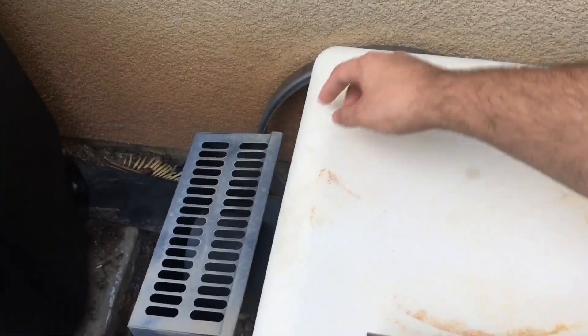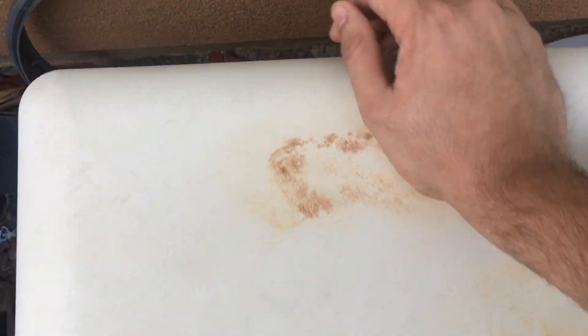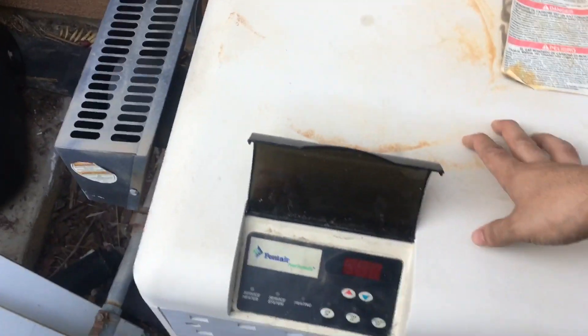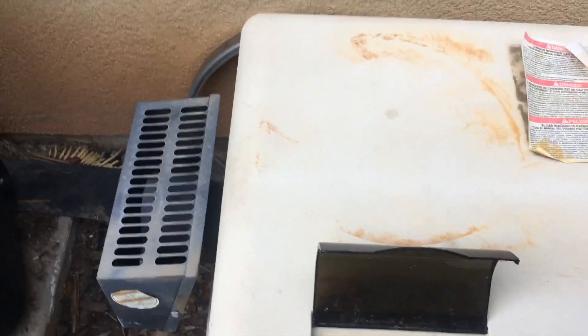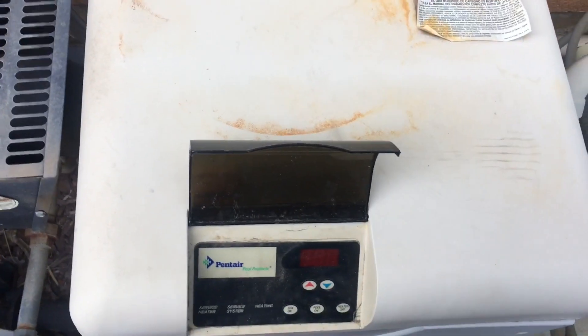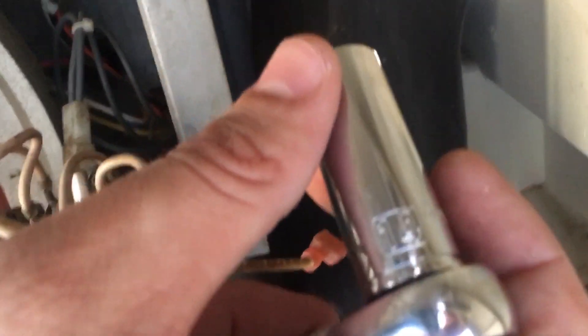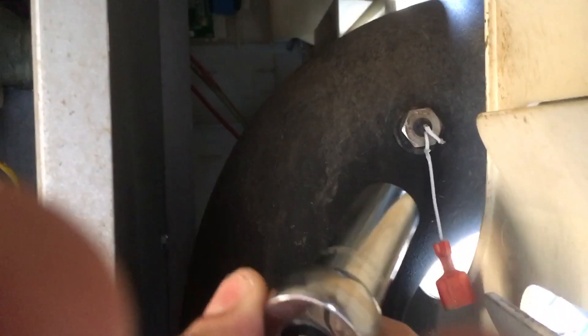The sensor screws into the side of the exhaust, and you access it from the back cover — four screws on the corners with grooved edges. There are two connections coming off of it, and rodents like to go in there and chew them up. I didn't feel like grabbing an actual wrench, so I'm using this 14mm extended socket, and that was the right size to loosen it while sliding over the wires. Now it's loose.